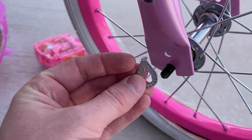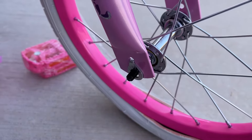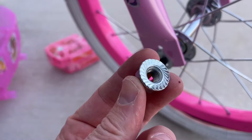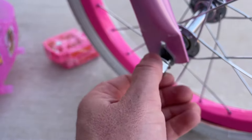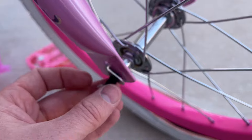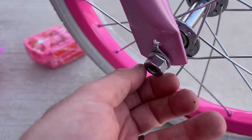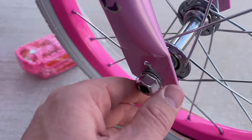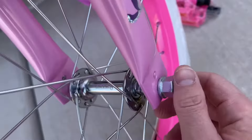As you look at this washer with the little clip on top, we're going to push this in and make sure that tab goes into the hole in the fork. Next, look at the nut — you want to make sure it has these perforated lines in it. That's what's going to keep it from backing off. Make sure it has those perforated lines on the back side of the nut, then put the nut back on. We want to install this evenly on both sides, so do not tighten down one side all the way and then move to the other.